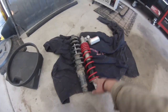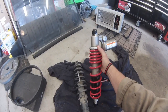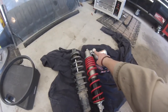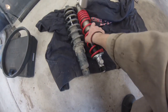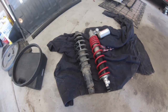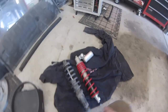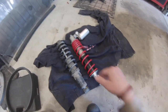The nice thing about the LTR 450 is it's adjustable. You have a better spring on it. You can adjust the preload with the tool, and you can also adjust how easily it compresses with this knob, and how easily it extends. That's really important to be able to adjust, because someone like me who mostly rides on trails with big rocks will set compression very low so the suspension travels smoothly. But if you race and go fast, you want these stiffer so you stay level going around corners quickly.